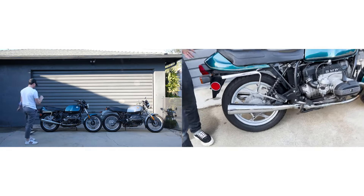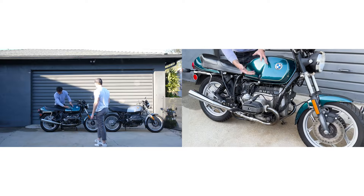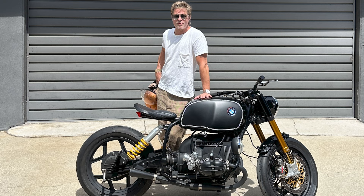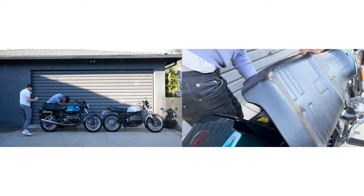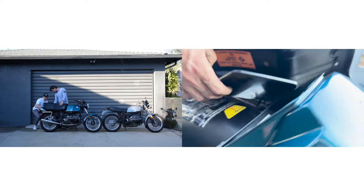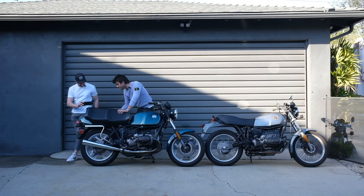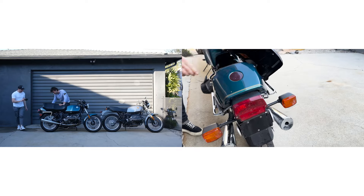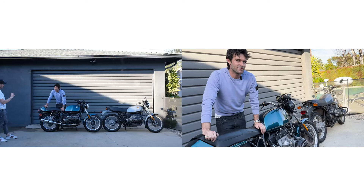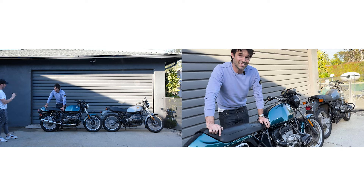Monoshock. You can imagine once you take all this off, you're left with the silhouette of this wonderful bike — Brendan's going to overlay a bobber. Let's see what it sounds like. Someone's been pillaging — no tool kit, no tool tray. Are the wheels salvageable? Oh yeah, we'll Cerakote them. You have to take the wheel off and inspect it because it's a drum brake — you have to measure the inside lining, because the wheel is actually a wear item.